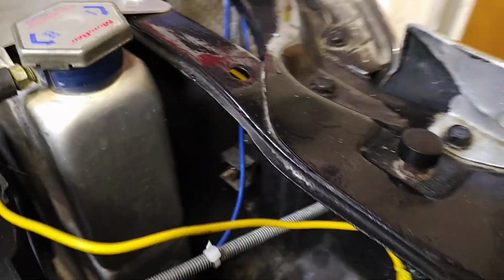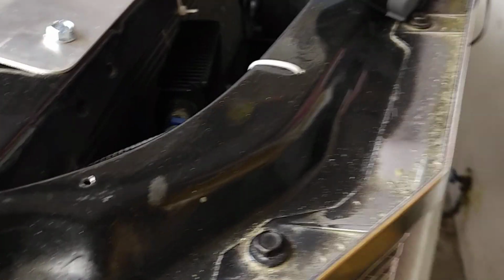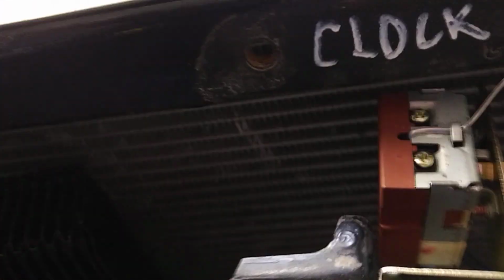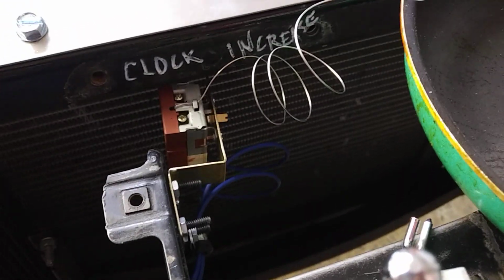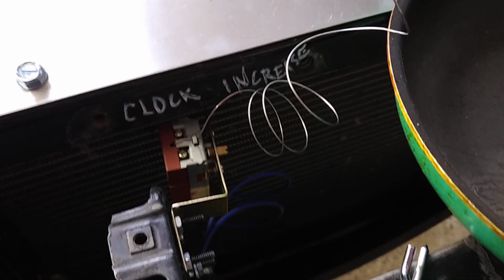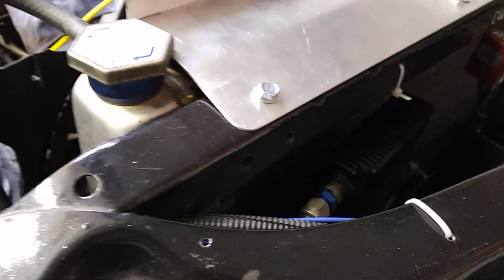And then lastly, you have your 85 on the relay, which is the thermo switch. Now, the thermo switch wiring on these Haydens, what you've got to do to run it off the relay is one has to be a ground. So I'm running the ground here from the Hayden. This is also the fan ground. And then one goes to the 85 spade. On the Hayden unit itself, the front one, the one closest to me, is the ground. Remember that, because these are sensitive. If you reverse them, the fan will go on even if the switch in the cab isn't on. So make sure you do that properly. Other than that, it's fairly straightforward. It just takes a while organizing everything.